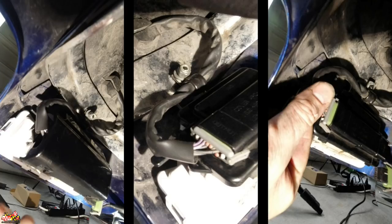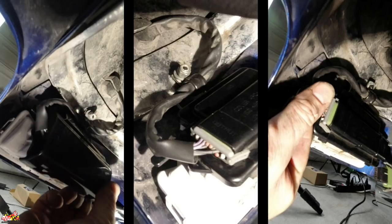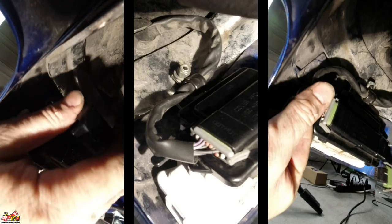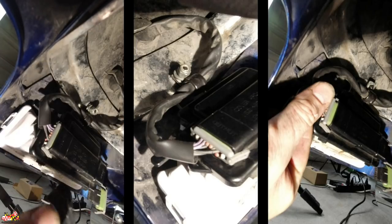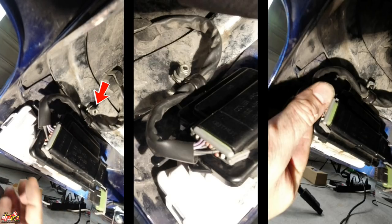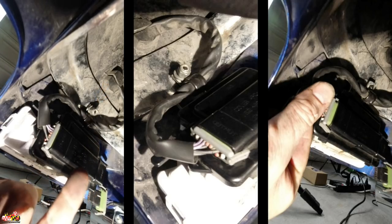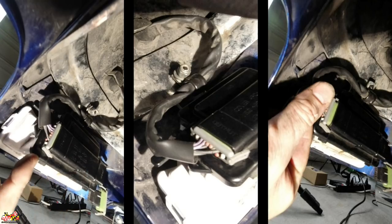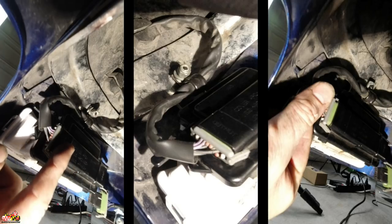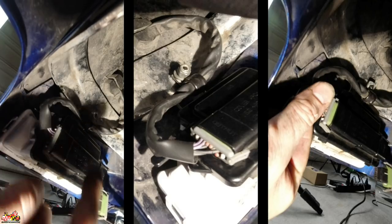It's kind of a pain with the camera here. First step is take off this black piece — all you do is just do that and it pops right off. Then you see that nut right back there. Now we're going to take the 7/16 socket and take that off, and then once we're done with that, we'll go through and pop these out, because these were covered by that black plastic piece. And then once these come out, all we have to do is take out the Torx screws, which are right behind here.